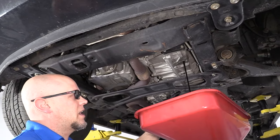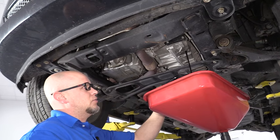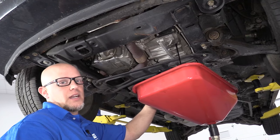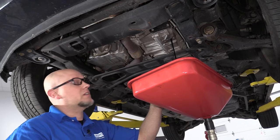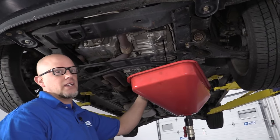When doing this, we're going to get most of the fluid out, or a good portion of it. We're going to drain it and then fill it up, then drive it around for a while and repeat the process. We don't have a flush machine — ideally it would be better to flush the fluid out, but we're just going to do what we can with draining and filling.